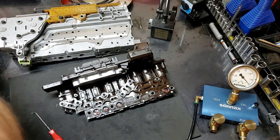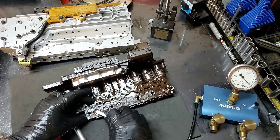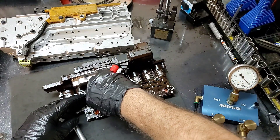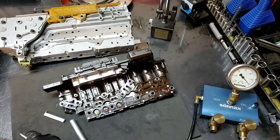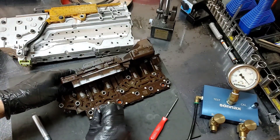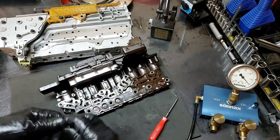Here it is right here — this little thing that looks like a boot. You get your membranes in there and position them. There's a rivet here on the side, so that's probably what was going on — it wasn't going underneath the rivet. Let's replace that one. To get it out you kind of have to destroy it since it's brand new. I'm going to get one of the extra ones and install it like an upside-down taco — get one side lifted, get it nice and flat.